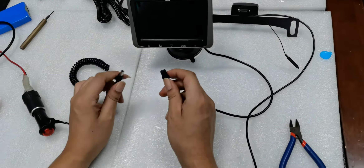The easiest way is to connect the monitor to the cigarette lighter outlet. Connect the power cord to the camera. The red wire is connected to the positive pole of the reverse light, tail light, or license plate light. The black wire is connected to the negative pole of the reverse light, tail light, or license plate light. Press the red button. The monitor lights up and the image appears on the screen.